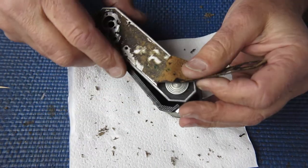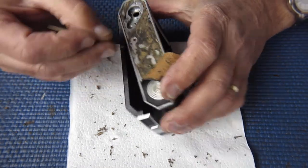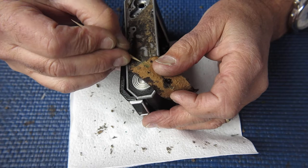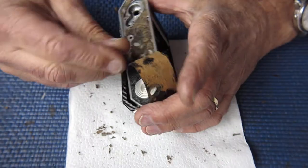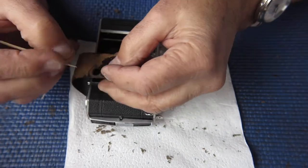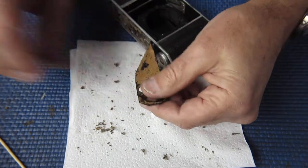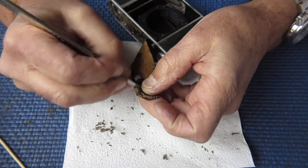Battery's changed and all back in gear again. Let's look at the Zeiss bumps on the base of this camera - basically it's the same deal. It's where there are rivets and the dissimilar metals - the aluminium body and the brass of the rivet - has created some corrosion, and one of the corrosion products is that green mess. I suspect it's technically a soap, because the soap is the sodium salt of a fatty acid, and I'm sure that's what we've got in this case from the leather and the dissimilar metals.